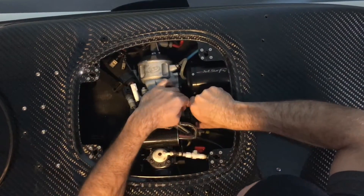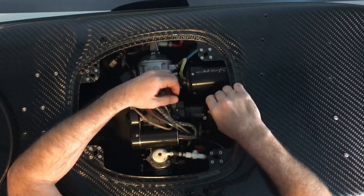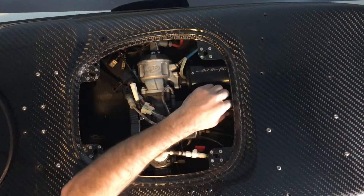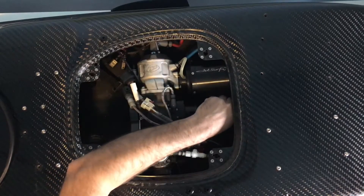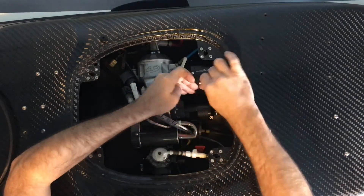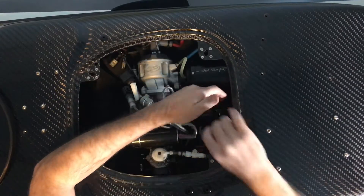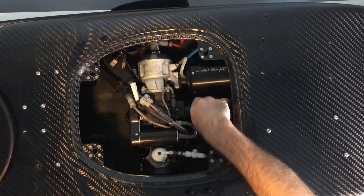You can see how it's just sliding back now. Some guys use screwdrivers and actually get in there and pry it back. I don't do that because this is just carbon and I don't want to mar it up — it's really not that bad to move it back by hand. So those are those two, and then you have this third one. You can actually reach in and turn the shaft from underneath, or even grab onto that retainer and turn it because it's not attached to the engine anymore, so there's very little resistance. Just turn that last one, break it free — this back one's a 4mm as well, identical to the other one. Slide them forward a bit.